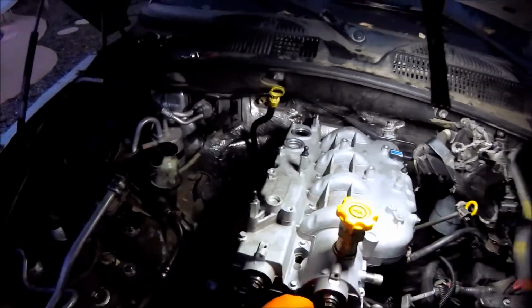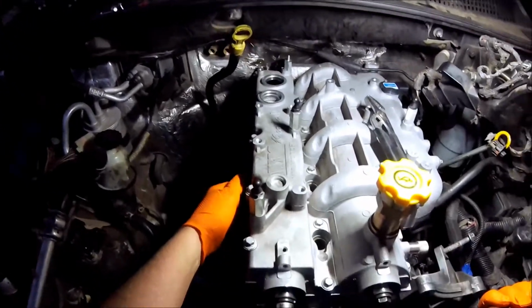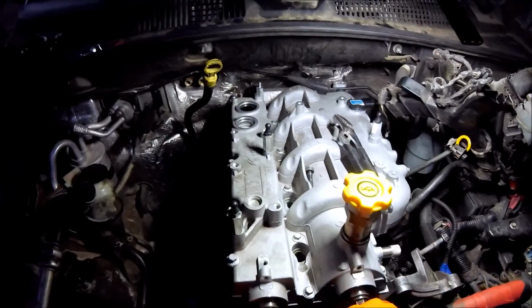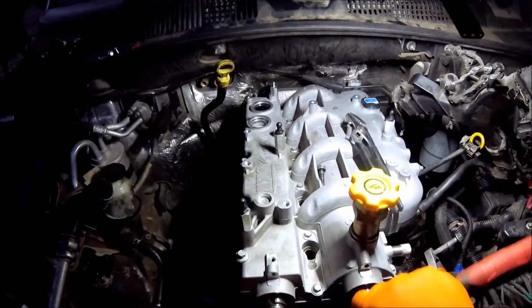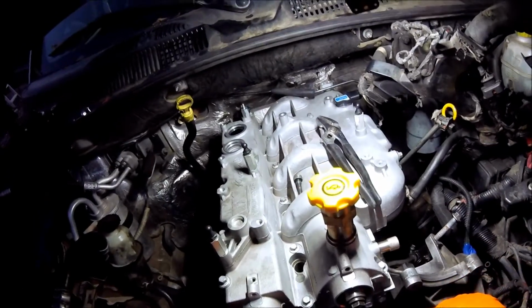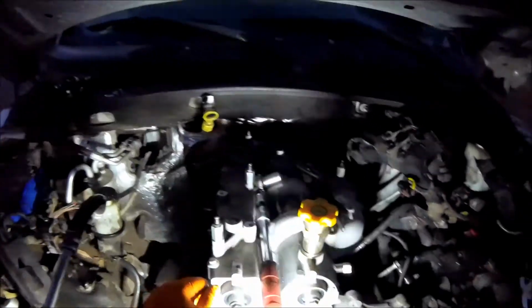There she is. Okay, now I'm going to try the same thing on the exhaust side. So the spring tension on those valves is keeping this tool in place, so it's going to want to snap over. Yep, here's 1, 2, 3, 4. Okay, so it seems like we got all of our rockers in place. That's good. Okay, they're both back aligned.